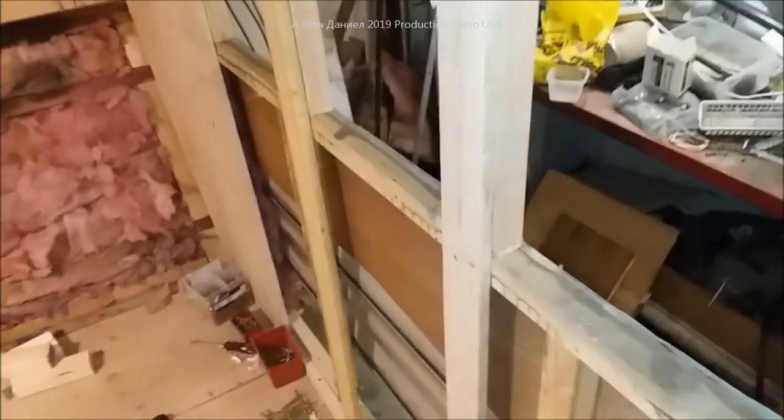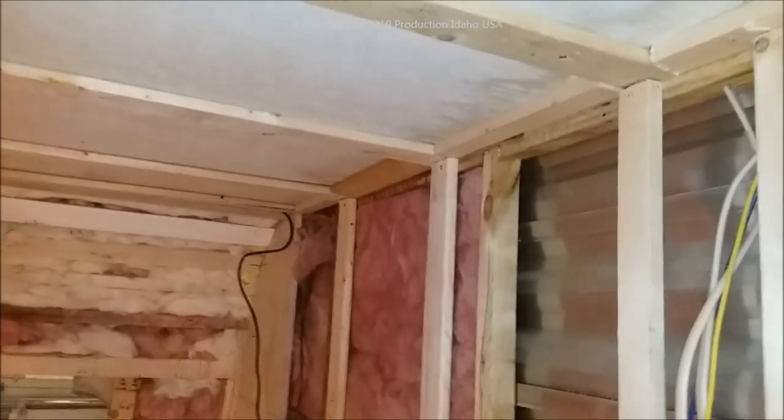So it is just solid now. This thing was really flexible with their construction methods of nothing but a few staples from here and there. Very flexible. So now it is extremely solid. The roof has been resealed and taken care of. So these are on 16-inch centers, each one of these going across. And that'll allow us to put our 3/4 inch foam in between here right on the surface of this wood. And we're not worried about moisture, it'll be well ventilated.